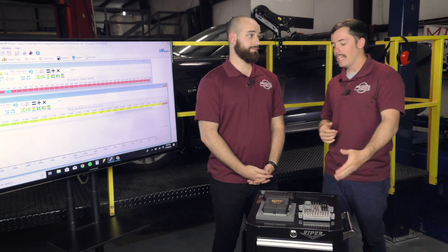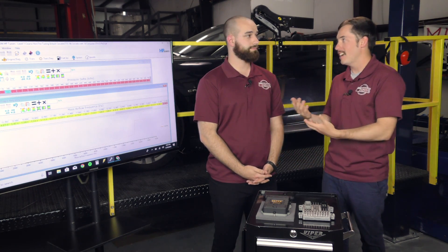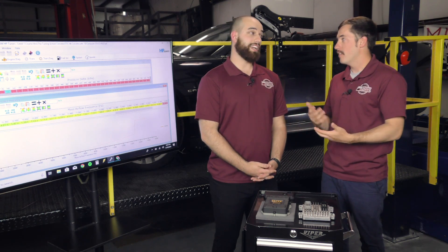I've personally made over 1,400 wheel horsepower using a factory ECU. But with that being said, the car had no traction control and was very laggy coming off the line because it had two large precision turbochargers on it. That's when we actually made the switch over to an aftermarket ECU — a ProEFI 128 — with a variety of different sensors, and we had a much better outcome. The car ran a lot better and was a lot more efficient. You could get it done on the factory ECU, but the standalone made it a lot easier and a lot faster.